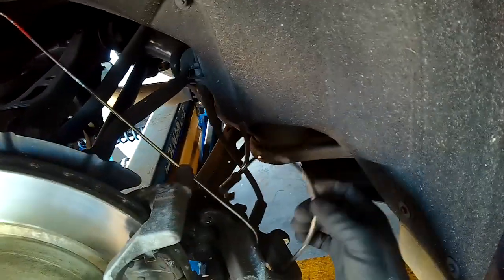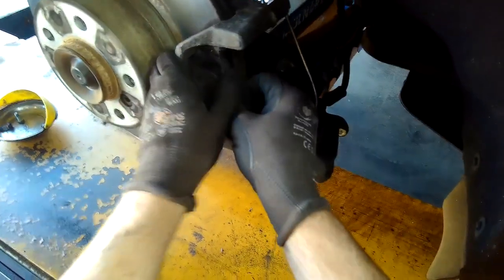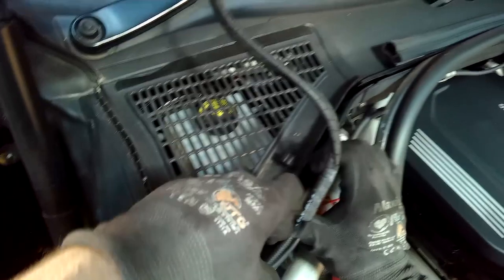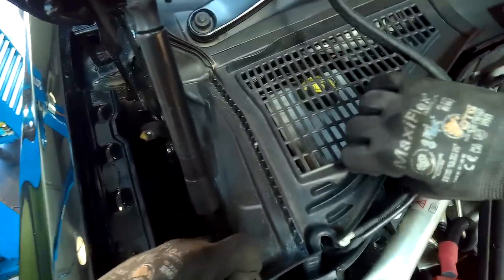The next thing I do is remove the brake pads and the wear indicator sensor. The wear indicator sensor is routed through a lot of different parts — it's clipped in and pushed in. You need to remove all of those items. There's a small black junction box that will pop open, and then a little electrical connector that just needs to be disconnected to free the sensor. I'm only showing the job on one side because the sensor is on the right-hand rear — there is no sensor on the left-hand rear.